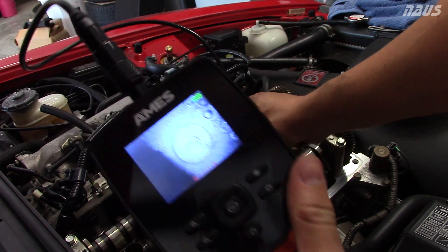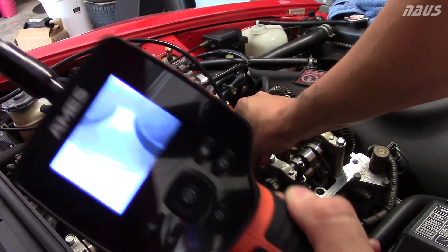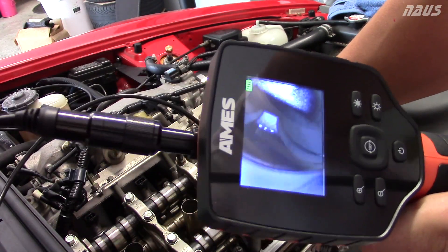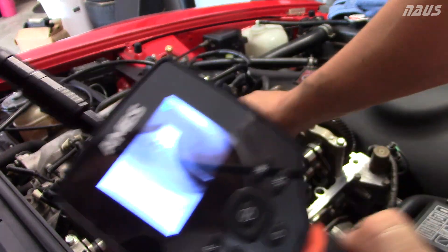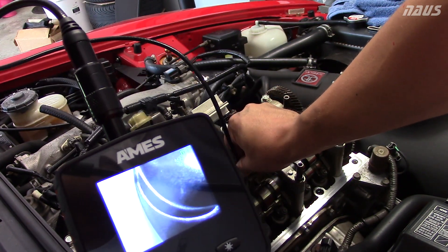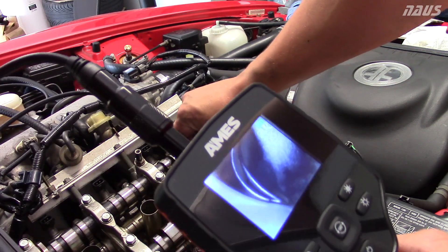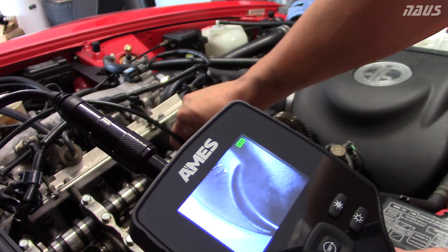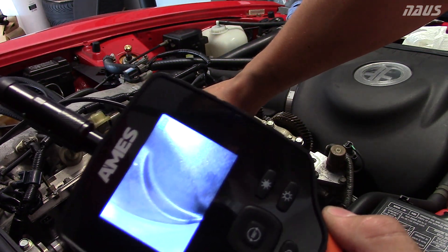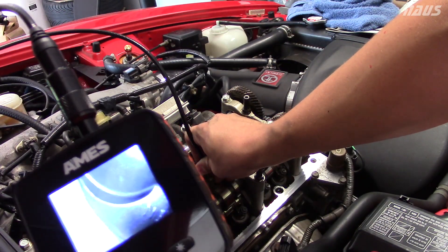It's got the PCX number on it - they're very clean on top. You want to try to increase the intensity of your light as much as you can. The lighting is a little off but I can rotate this around and see the seats of the high-compression pistons - these are stock Honda pistons - where the valve would have made contact, right in that pocket right there. I'm going to swirl it around and check the other side. It's not super HD, you're not going to get perfect clarity, but for a Harbor Freight product it gives a really nice picture.